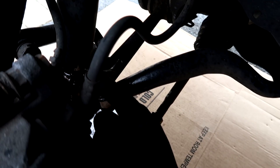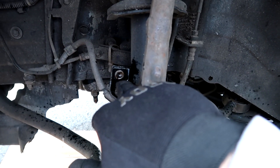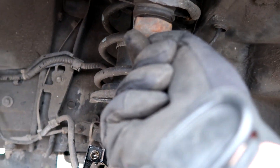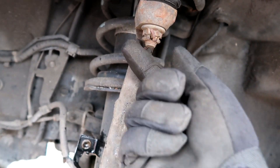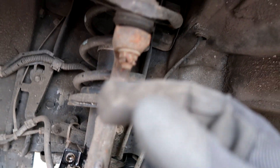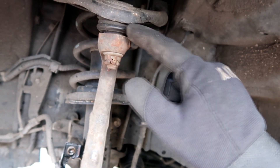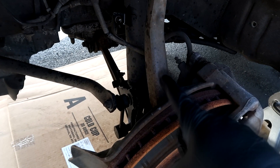For the coilover install, really the only bolts we're gonna have to take off is this nut right below my finger, and the bolt that attaches to that nut. Then we're gonna take off this bracket here for the brake line. We also have to disassemble the ball joint here, and there's a cotter pin along with another nut. Then we have to work from under the hood to disassemble the top hat as well. The ball joint is our main concern because the last time we worked with one it wasn't the smoothest process. After the bolts have been squirted with WD-40, we let them sit for about 10-15 minutes.